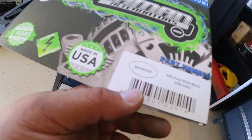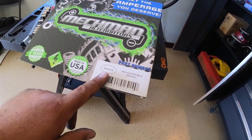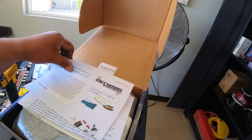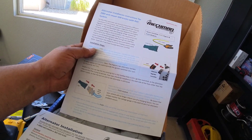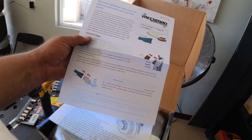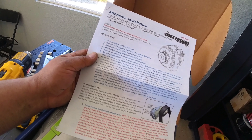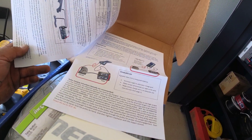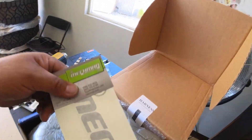Here's the new Mechman alternator — part number B8206400B, a 400-amp billet alternator. It comes with a pigtail to fool the computer into thinking it's the stock alternator, but the alternator is internally regulated — that's what the instructions are about. It's hot out here dealing with this fan. The instructions also talk about the belt — I haven't gotten a belt yet because I'm not sure exactly how much smaller I'm going to need.